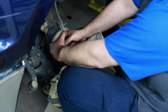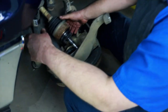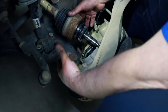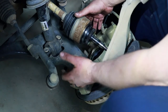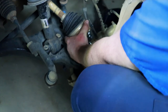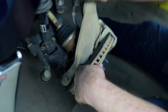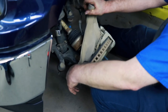All right, you got to tell everybody where they got to be super careful when they're doing this. If you're not real careful and you don't get everything lined up as you're going back together, you can actually break this actuator. And unfortunately, if you break it, we don't replace it under warranty. So the best thing to do is get it started, and then we're going to roll the jack in and kind of raise it up and get some pressure off of everything.